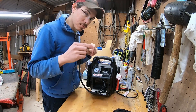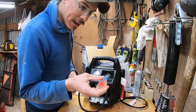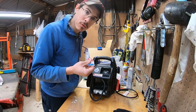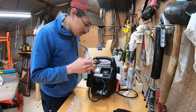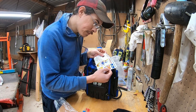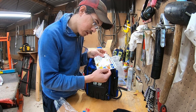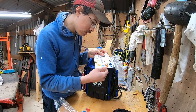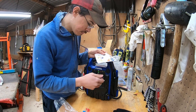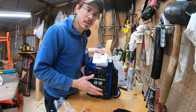It comes with a hose already - this could be a game changer. We've also got this little pack of accessories with needles so you could inflate footballs, basketballs, soccer balls, all that stuff. It feels very flimsy though. The instructions say: wait five minutes after turning clamp power on before starting ignition - the vehicle will not start if you don't wait five minutes, so I guess that's to quick-charge the battery. Hopefully on lawn mowers I wouldn't need to wait because they don't need near as many amps. This thing is way overkill for a lawn mower, but I can use it for cars too.